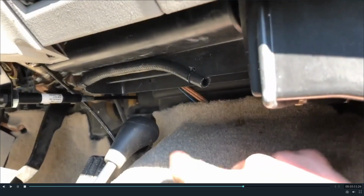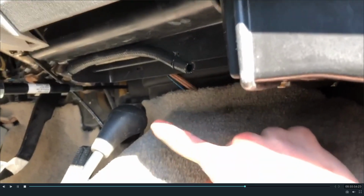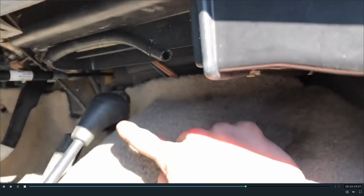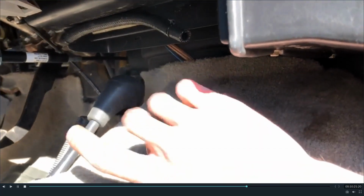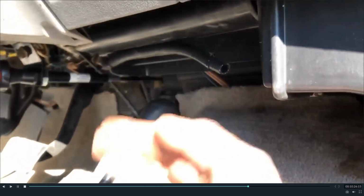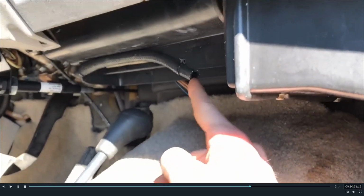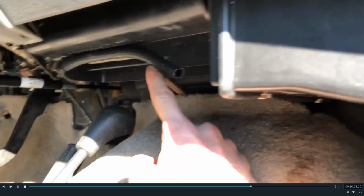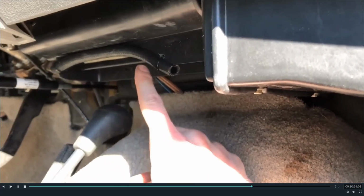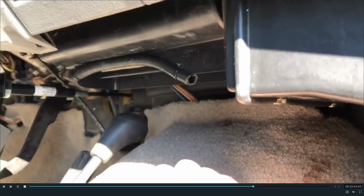If you're going to mount it up there, you're going to have to remove the vent extension that comes off of here, if you're going to do it like this, because the 2-high position sits all the way forward in here, and you can see on the other one, that 2-high position sat pretty vertical. We did take a piece of old fuel hose, drilled two little slots in there after dremeling out a good bit of this material, because you kept catching the top of your thumb on there when you'd shift it.